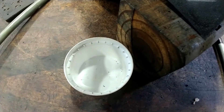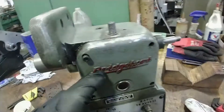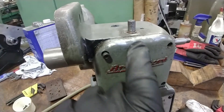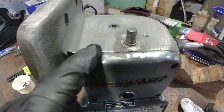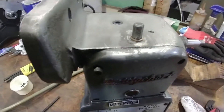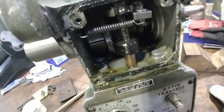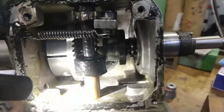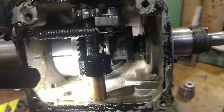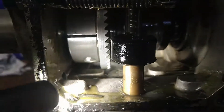There's all the oil that came out. Next up we take off the cover and see what's left of the insides. The 6F has a detent pin behind the cover that holds the handle in whichever position you put it. The fact that it's not sprung out yet tells me they probably added silicone sealer. There doesn't appear to be a paper gasket at all — looks like they used silicone sealer instead. Surprisingly, I don't see any ground metal inside; it looks pretty clean and the ring gear seems to be in good shape.